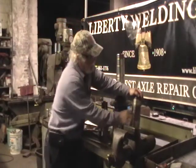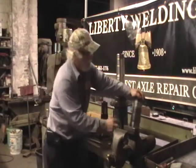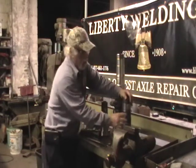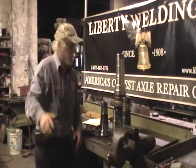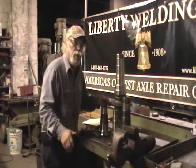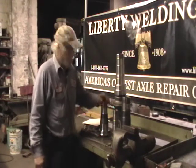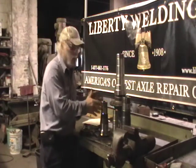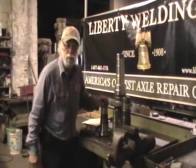See this spindle here? Some tractors like John Deere make with backhoes and stuff like that — they've got a planetary on it. You've got the inner bearing, outer bearing, then a spline on here that the hub's got a planetary on it to power those big wheels. We've even put those on. It's adaptable to that — adaptable to all your foreign vehicles in the metric system. This is the best system out there. It's adaptable to just about anything that has a full floating system spindle.